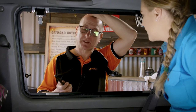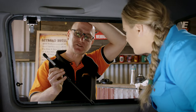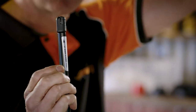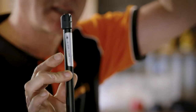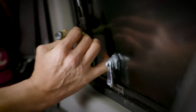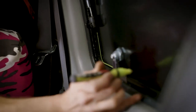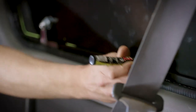So now we're up to one of the final steps of installation — we're going to put the gas struts in place. The only thing to remember with these is that you have to have them this way up; there is a label on the top that lets you know. They just pop straight over the strut mounts. So now we've just got this little chalk pen — because the door's now in position, we'll just make some nice marks around in the corners so once it's open, we know where to follow to stick the rubber on.